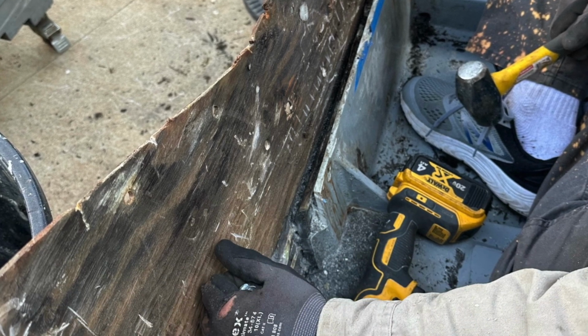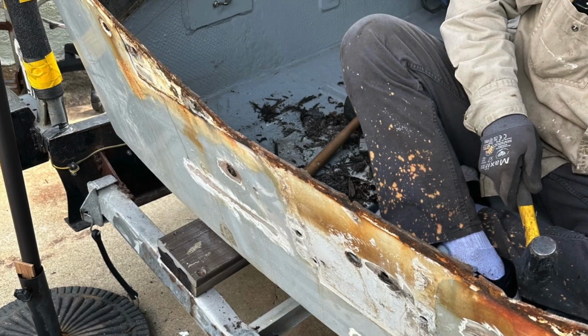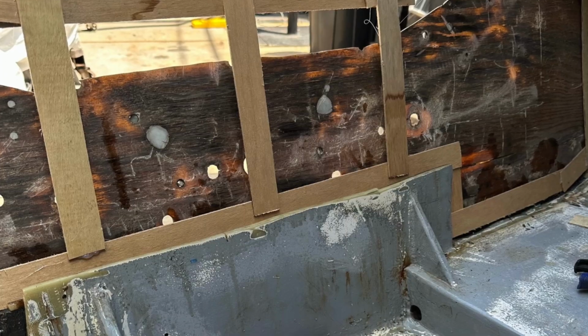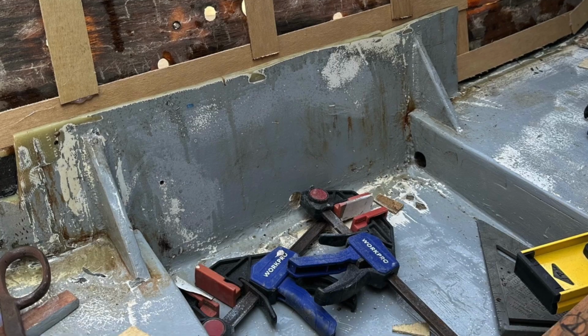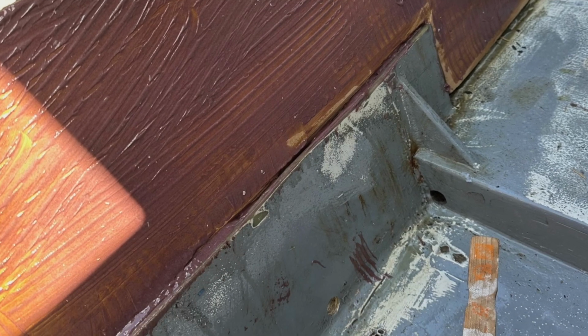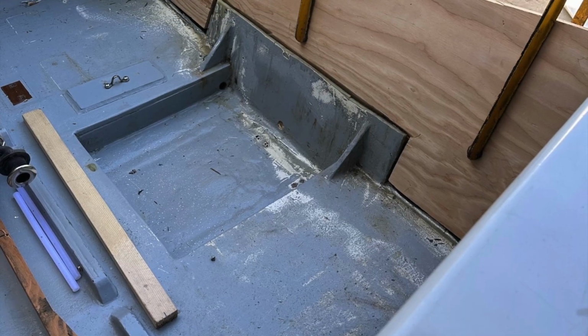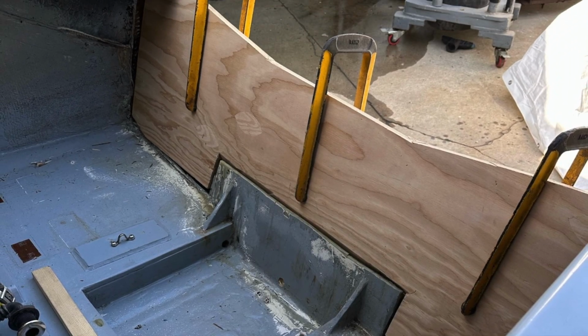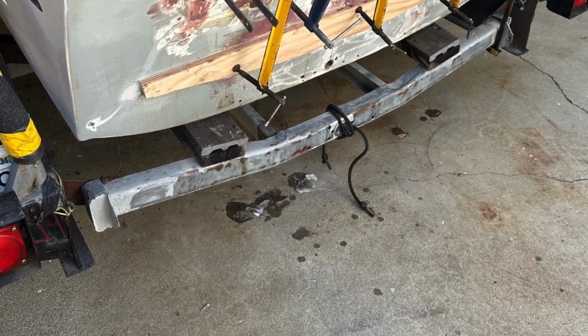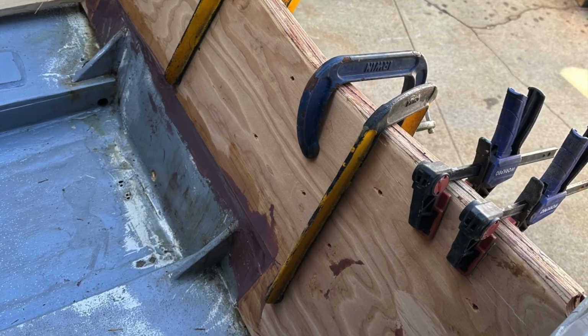The entire transom of the boat was removed and replaced, and the transom was reinforced with carbon L brackets and lots of E-glass to tie the aft section of the boat onto the motor well and transom as to be as structural as possible. Noting that the 75 horsepower motor was probably a bit more powerful than what is designed.